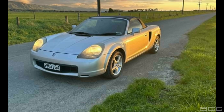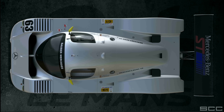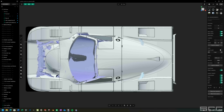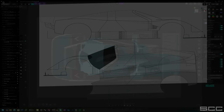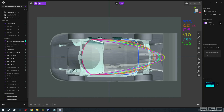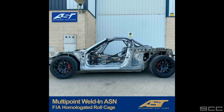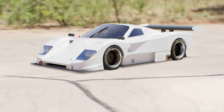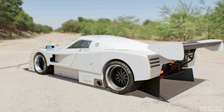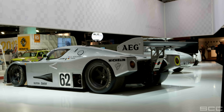There are quite a few design considerations to think about. Firstly, the front windshield — it's the only part of the donor car visible from the outside. Group C cars have a really nice teardrop shape, but on the MRS the front windscreen is quite a bit wider. We had to cleverly sculpt it to work with the Group C silhouette, doing a design study overlaying a whole load of different designs to get the right proportions. The plan is also to have a full cage that closely follows the roof of the cockpit for bracing and rollover protection. Just like the windscreen, the wheelbase was very slightly shorter, so we deliberated heavily on wheel and tyre specs. The idea at the moment is to go 17-inch front, 18-inch rear — a nice meaty sidewall will give us that true Group C aesthetic.